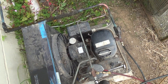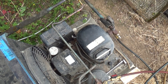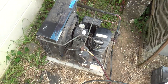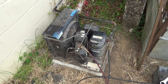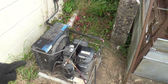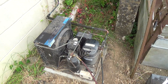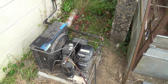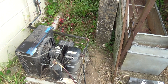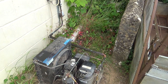Will she work? I think we might have got away with that. I think that would have struggled before we changed that cap. The issue before was it wasn't that it wouldn't start - it would start and run, and then it would knock down and go off on the fuse. I need to find something to cable tie that pipe up - a bit of rubber or something to put between the two and cable tie them together so they can't rub. We've got an anti-rub rubber piece. I've shut the door on the cold room now so we can pull the room down.